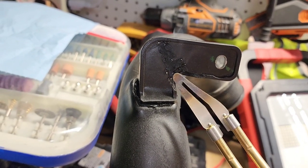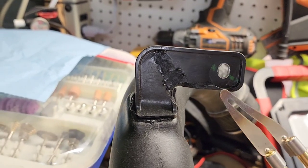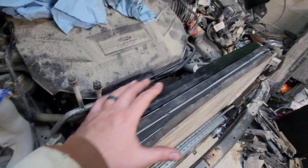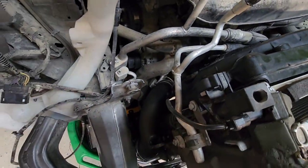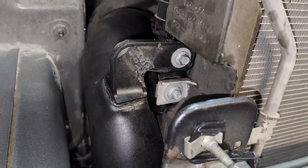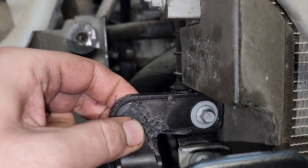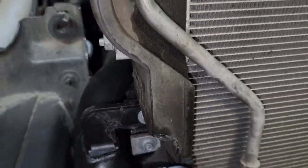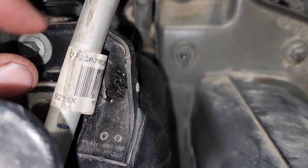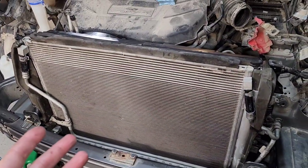This side's done. I'm going to let it cool for a second and then do the back side and then the top, so the crack all the way around is melted together. There we go — it's magic. Everything's installed and hooked up down there. You can see my plastic weld job — you can kind of see the crack a little bit now since it's flexed slightly, but it's much, much stronger, actually connected. The other side is also much better.